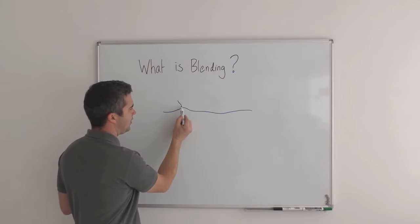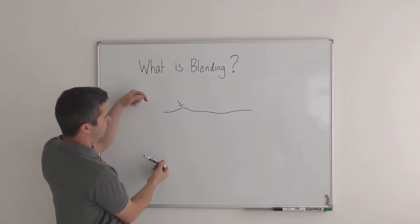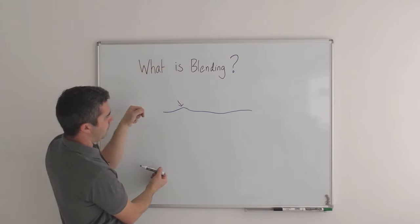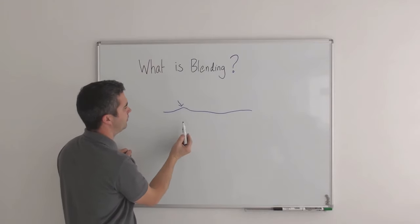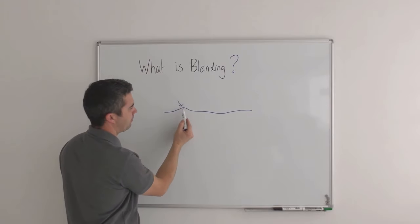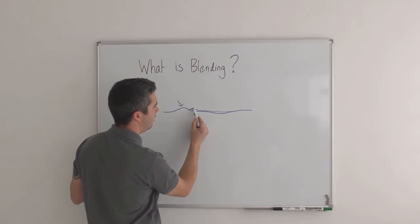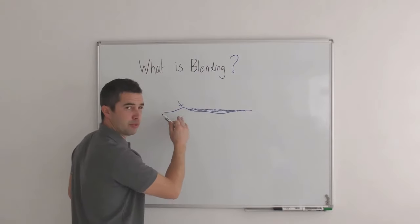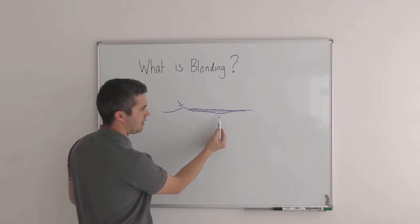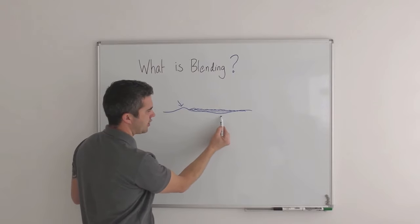By tapping down this section, sometimes with a bit of an angle on the hammer - so rather than coming down directly flat you're coming at an angle - you're effectively sending the metal that way. Each time you tap it you're creating these little waveforms, these little energy ripples that go across the panel. As that metal comes down it's sending this section - this little low - starting to come up again.